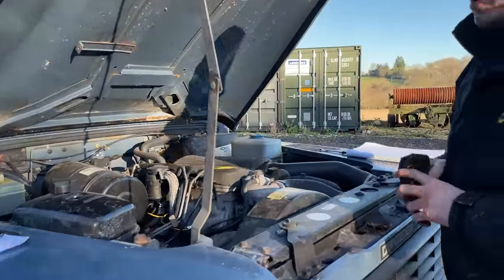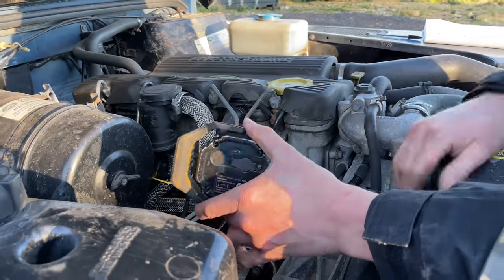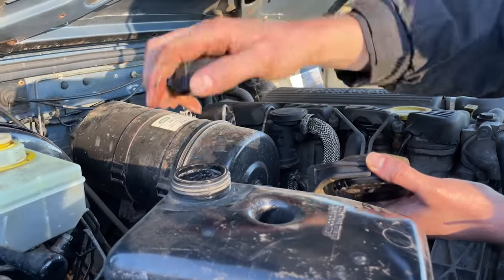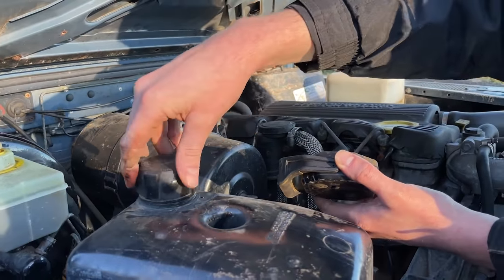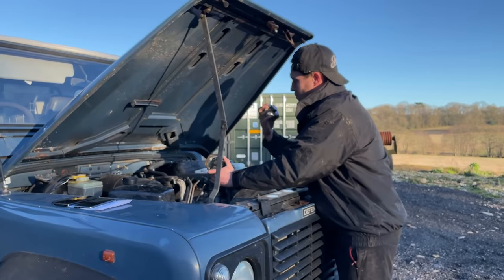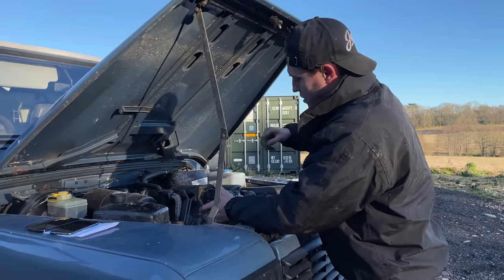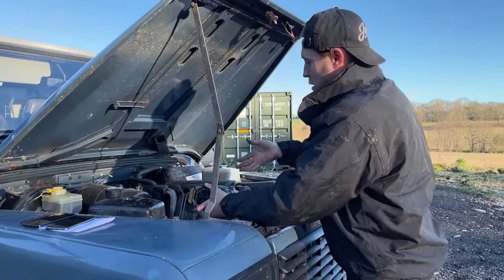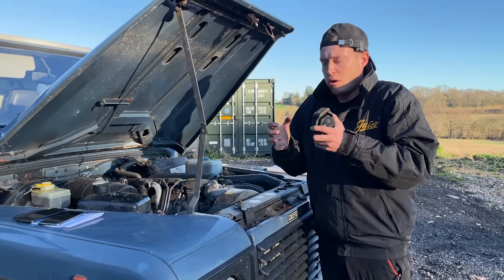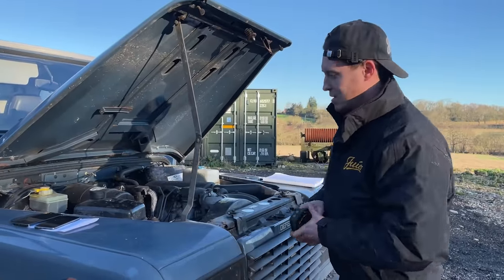Engine inspection is pretty simple on a Defender - just make sure it's dry. As long as it runs and it's okay, check the levels. Your coolant's in here - make sure it's actually got coolant. Check the oil filler cap and give it a smell - it doesn't smell crusty or burnt. Just because the engine is dry tells me it's been well maintained. If an engine runs out of oil because it hasn't been serviced, it will get too hot, all the gaskets will fail and it will start leaking - then somebody potentially poured oil in pre-sale and you've got a horrible leaking mess to rectify.